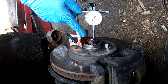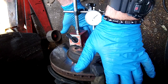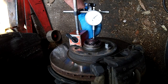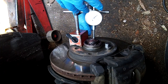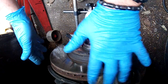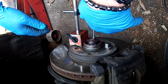I've set this dial gauge up. You've got one screw retainer inside the hub — the disc brake hub. You can leave the caliper on for this; it's not going to make much difference because the amount of movement is so minuscule and the caliper is not going to restrict it. Put the screw that retains the brake disc into the hub, then put another wheel nut on the other side — just tighten it snugly by hand. That's just to keep disc wobble from affecting the measurement.